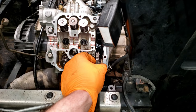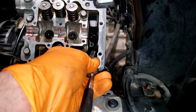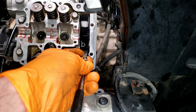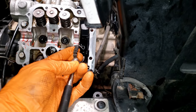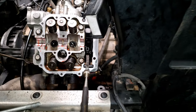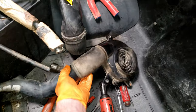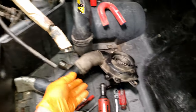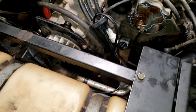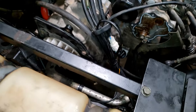Let's begin — you want to make sure you have your piston located around top dead center, so take your spark plug out and confirm that, and make sure your timing chain is going all the way down to that gear. If it jumps off the gear on the bottom you're gonna have to get in there with a long screwdriver to make sure it's on. Get both your timing guides in, then come over here and remove this air duct — it's got five 10-millimeter screws holding it on.